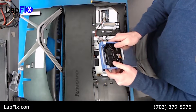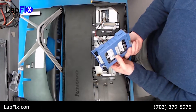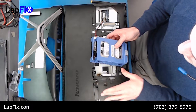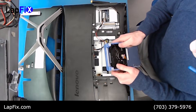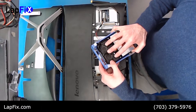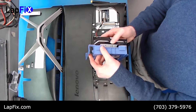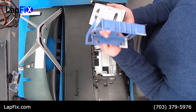And that's pretty much how you can replace it — you just put it back the same way you found it. You can put in a solid state drive if you want, but you have to make sure you have a bracket because this slot is mainly meant for a desktop-size drive. Just keep that in mind. If you buy one at a store, usually for a laptop drive you just need to get the bracket for it.